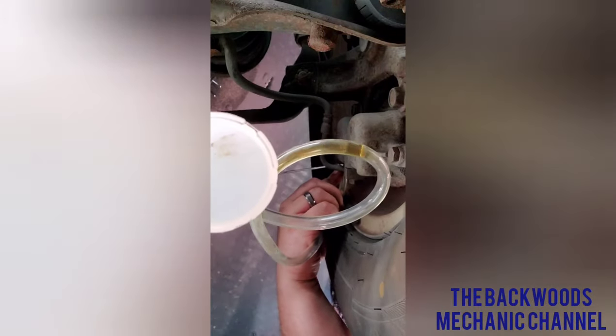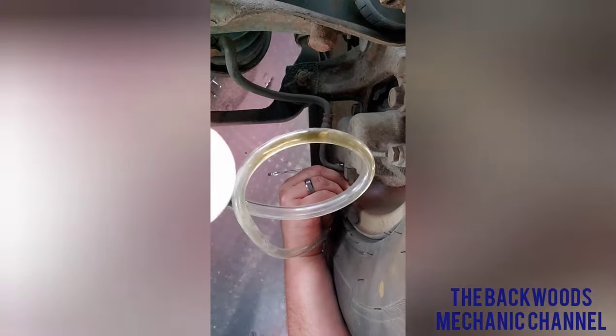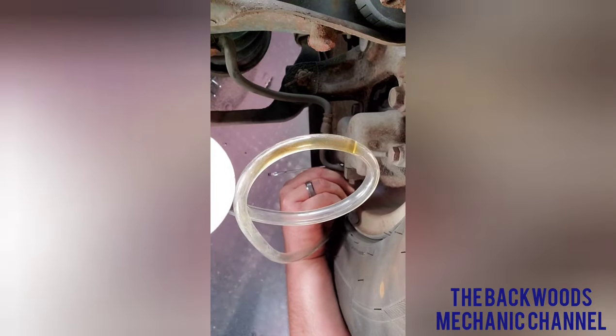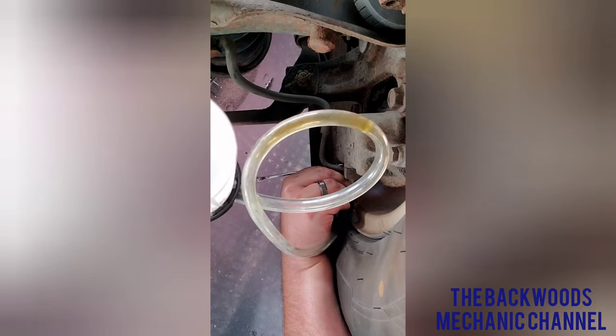Put this directly under this hose because there's something I want you to see specifically. I'm going to hold it nice and tight and put pressure up to about 20 pounds again. There's no brake fluid actually going into the reservoir — that's because there's air coming out of it. When I release this you're going to see the air bubbles coming through that hose. If there's no fluid coming out, it's because it's sucking air out of the line. As long as it's sucking out that air, this is doing its job — and there was a lot of air in this line.